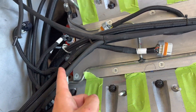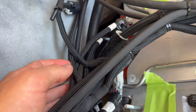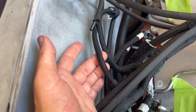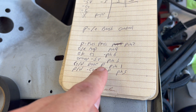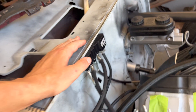We used the map sensor wiring off of the main harness - I cut it out of the main harness and ran it all the way back through. So now the map sensor wiring is in here for our 5-volt, our ground, and our map signal wire. We have our fuel pressure signal wire and two more inputs for our dome pressure sensor and coolant pressure sensor - that's how you see all six of those wires. Now all we have to do is make two inputs on the J2A or J2B for the Dominator, and we'll have a dome pressure sensor and a coolant pressure sensor.